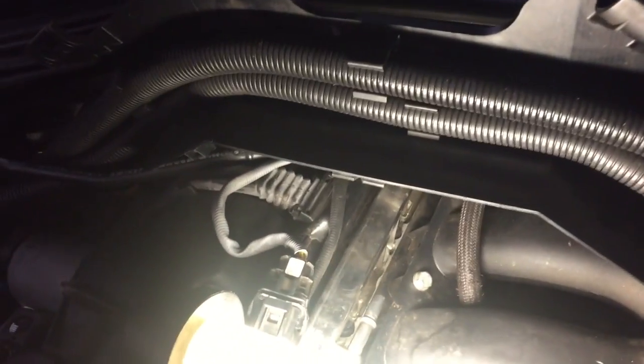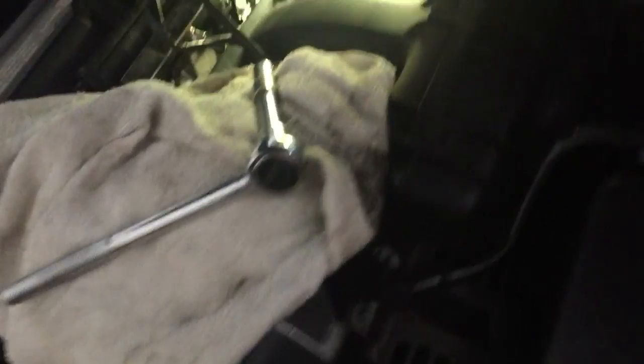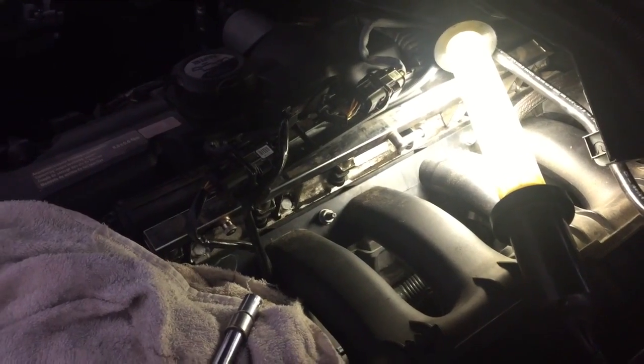Let me bring that light over. So there's the bolt head. I was able just to put that on, get the ratchet up as straight as you can always, and then get it up nice and tight. And the one over the back, as I said, I had to stand up those pipes. Again, I put the light there so that we can then come over the top, and there is the bolt over the top of the fuel hose there, and then I could get that on again, straighten up as much as possible, and then do it up nice and tight. Now again, these are just little 10 mil bolts going into an aluminium head, so you don't give it everything you've got, particularly when you go for the big tools. Just pull it up tight, and that's it, because they weren't tight to come out. So that fuel rail is now back on.